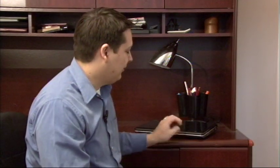If your laptop fan is still running very loudly after that, chances are a ball bearing is loose inside of the fan and you're just forced to replace it at that point. My name is Dave Andrews and I've just showed you what to do if your laptop fan is running loudly.